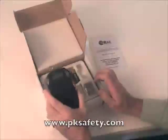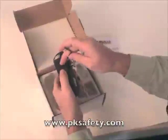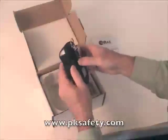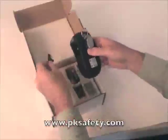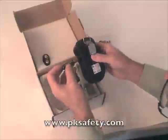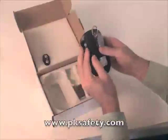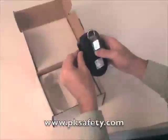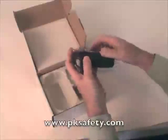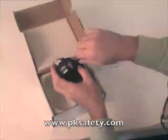The unit comes with the batteries separate, so I'll give you an Allen wrench here. There's a compartment on the side — we'll open up here, just back that screw out and pop the cover off. There's an indication on the back of which way the battery should go, so we'll just stick those in there. Pop the cover back on, and then tighten the screw down with the provided Allen wrench.